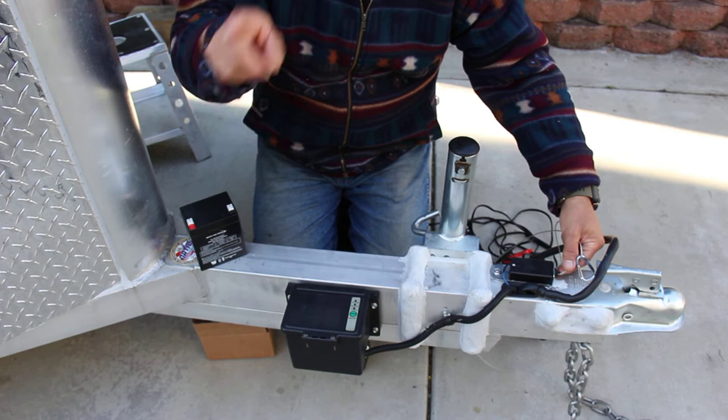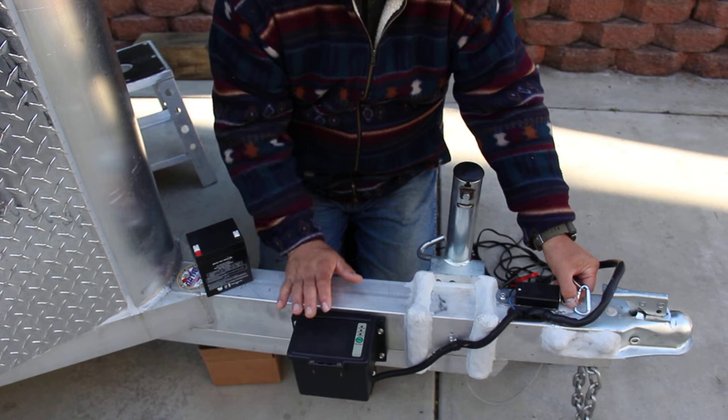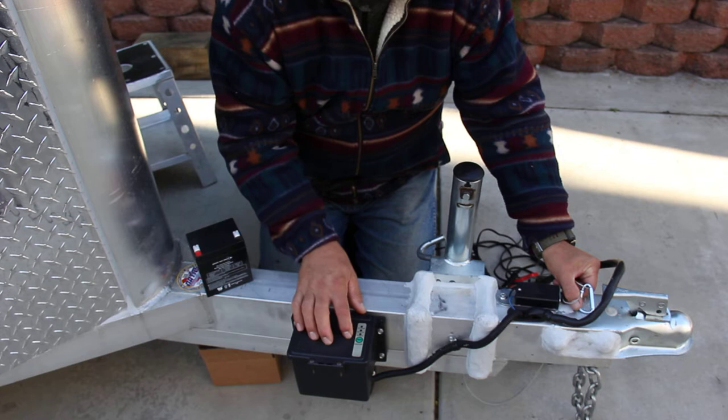What's gonna happen is your wheels are gonna turn, your trailer gets disconnected from your vehicle — this is hooked up to your vehicle — the pin pulls out here and your wheels are supposed to stop. So if you have one of these you're supposed to have it in working condition; that's the law.